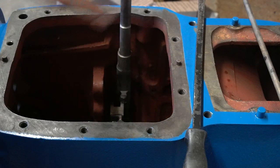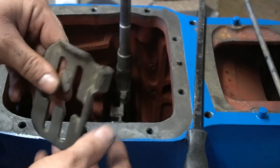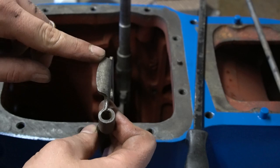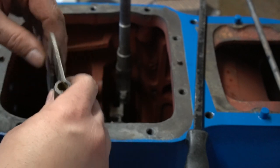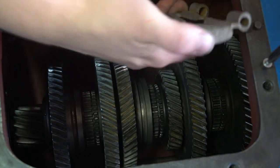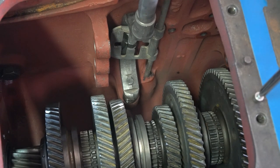Now that we have our shifter installed, the next thing to install is this shifter gate. The manual just says install it with the flat side towards the case - but the problem is, what's the flat side? The best way I've determined: you look at this edge, there's a 90-degree here, this edge there's nothing. This is the top. So when you put this into your case, this is going to be pointing out. We'll slide the rod through the hole up here next to our shifter.